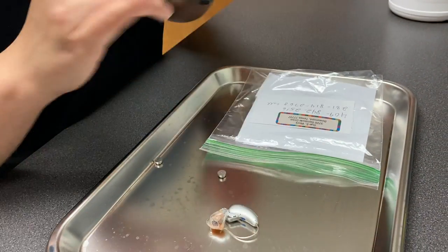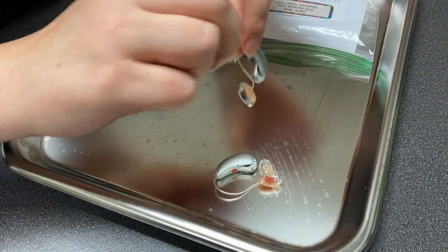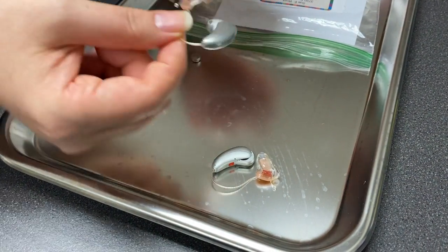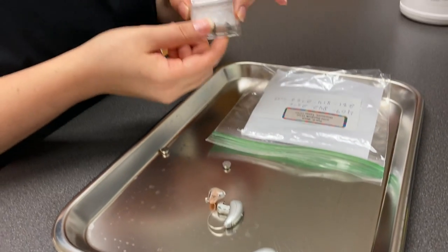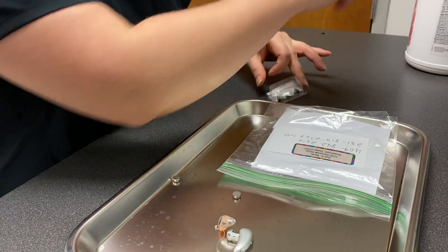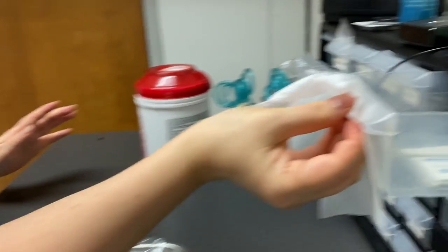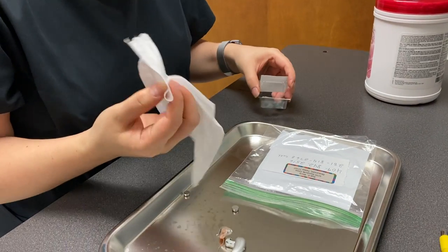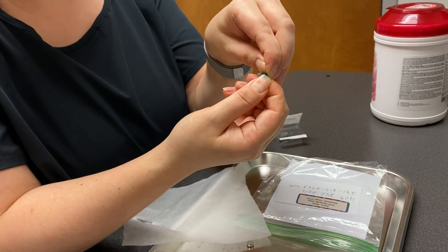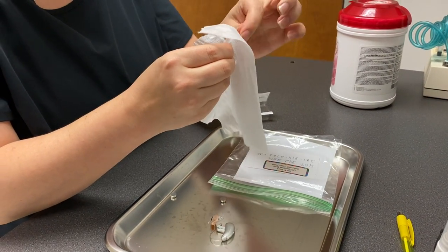They come in the ear mold type and the dome type. Some ear molds can come off, some can't. You can tell by looking — if it's fully fused, it does not disconnect, don't yank on it. If it's the dome type, the domes come off. Every time a hearing aid comes in, you pull the dome off using an alcohol prep wipe, because if you grab it with a bare thumbnail, you can't get that ear wax out from under your nail.